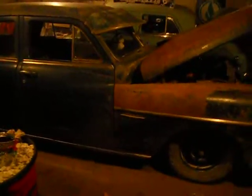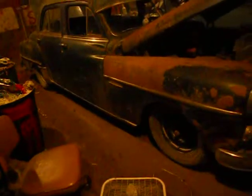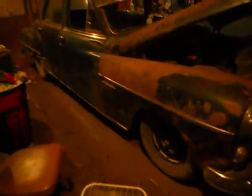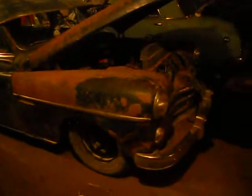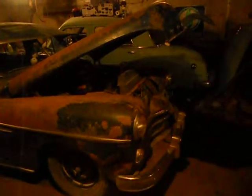I got my lights working. Let's go over what didn't work on my list last time: brakes are fixed; the rear end — there's just one plug in there, I checked the oil, cleaned out some old oil, added new oil, so the rear end's good; generator's getting worked on; gas gauge I'm currently working on; have not carpeted the trunk; have not finished my carpet inside yet because I was working on the brakes. Hood still needs to get perfected — there's a long carb spring on there I don't think is even supposed to be there, but I'm leaving it. Still have to silicone the radiator hose because it leaks a little, and once I silicone it I can fill the radiator up again.